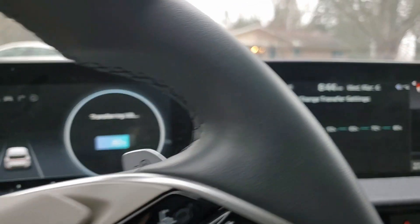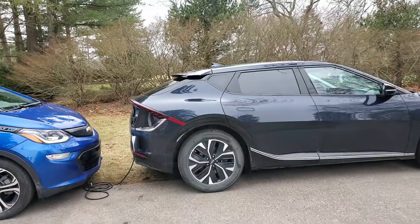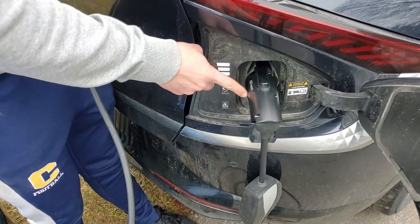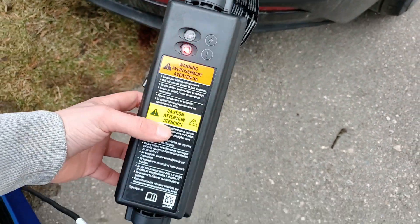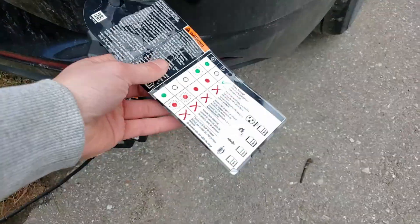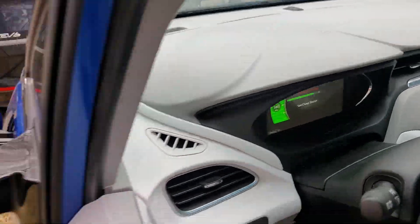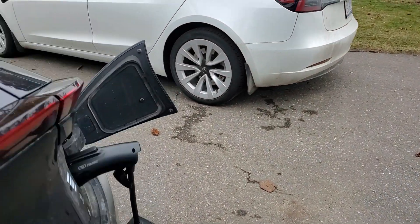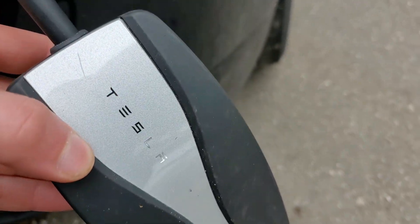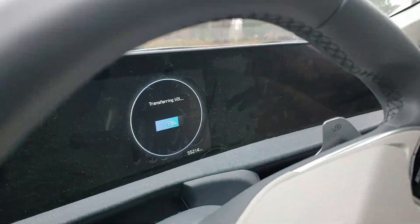Let's check out the Kia to see if there's a reason. There are no errors on the Kia EV6's screen, which means the vehicle to load is working just fine. We have our Tesla mobile connector here just to make sure that it is the adapter's fault that it's not properly grounded and not the charging cord. The EV6 says it's providing power properly, and over here it still says transferring vehicle to load.